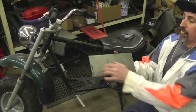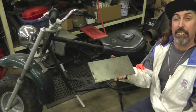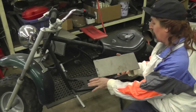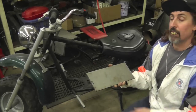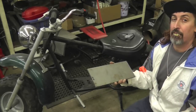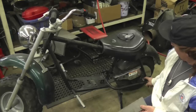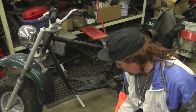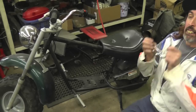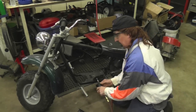And then I'm going to keep it bare like this, because when I put my torque converter and get my engine all built and I need to line up my sprockets and everything, then I'm going to punch my holes in there, because I only need 4 holes to hold that motor down. This don't have to be slotted, because I make my chain adjustment here, because I'm putting that torque converter on there. So make sure you wear safety glasses if you're going to do this.